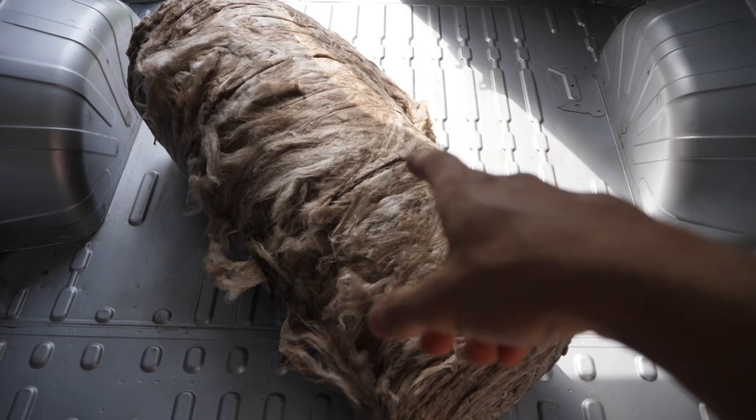This is probably quite a crude way of doing it and it's not the neatest, but you're never going to see it anyway because it's under the floor. There are a couple of better ways if you have the equipment: one would be to weld the hole shut then prime and paint it, or if you have a rivet gun - I don't - you could put some rust inhibitor in first, then rivet the hole shut. You can also silicon seal it - I've seen this quite a few times on forums.